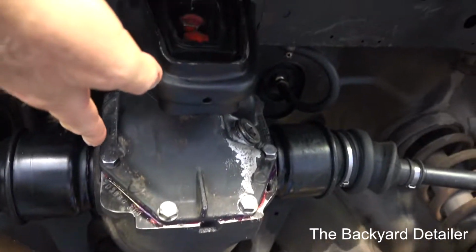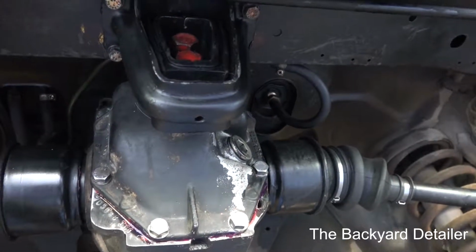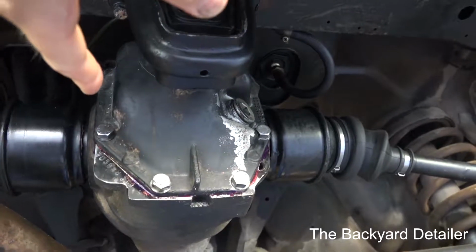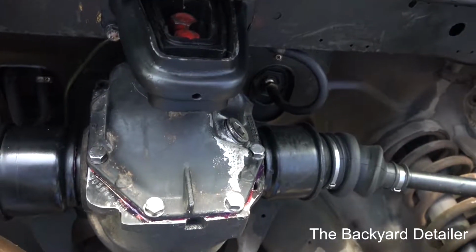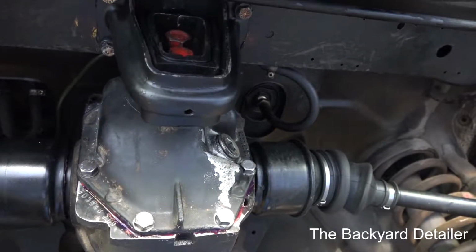Now, when I put the cover on, most people just use RTV, and that's not the proper material that you should use. Anytime you're using a metal to metal seal, especially on the rear end, you should use an anaerobic gasket sealant, which is what I did. I'm going to put a link to that down in the description.